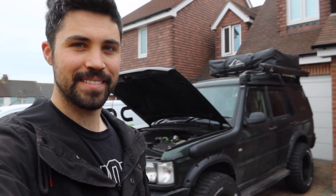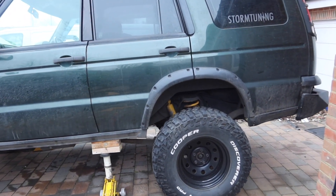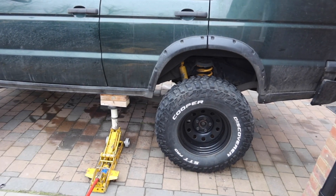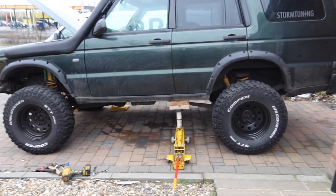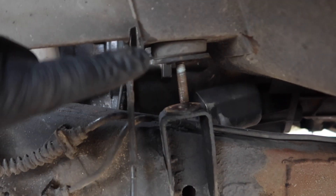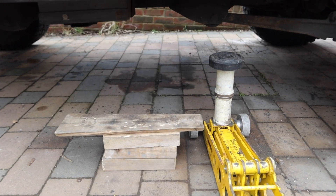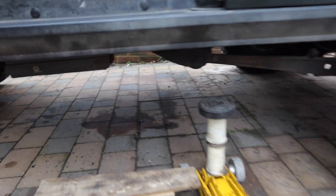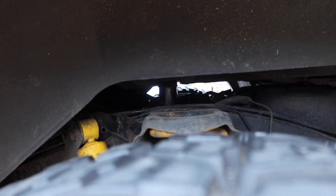She's coming up — that's about two inches, maybe a bit less. Obviously there's some suspension travel to come down a little bit. I've ended up taking the side step off as well, so I might put rock sliders back on it. We do need some sort of step since this is our family car and daily driver. You can see the gap there — that's what we need to slide those bushings back in. I'm putting three blocks and a spreader plate right underneath the B-pillar. This vehicle is already two inch lifted on the suspension, and those are the blocks fitted — you can see that right in the middle.